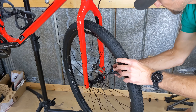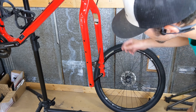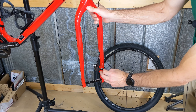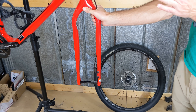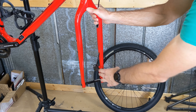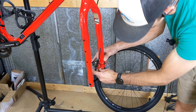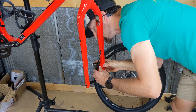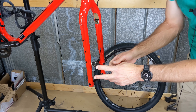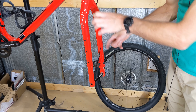The next thing you're going to want to do is take off your front wheel. You can just sit it off to the side for now. If you are using hydraulic disc brakes, you're going to want to put something in the pads here to keep them from compressing — so if you accidentally push on your lever, the pads won't be pushed together. You have little blocks you can use that snap into place. If you don't have those, you can just cut a square out of cardboard. If you have rim brakes, you don't have to worry about any of this.